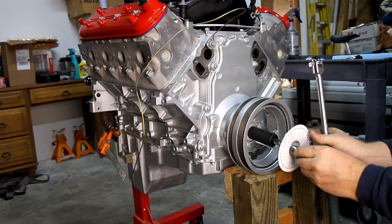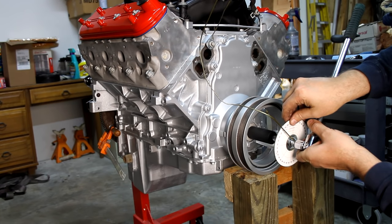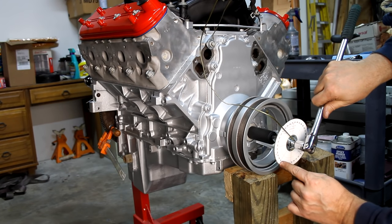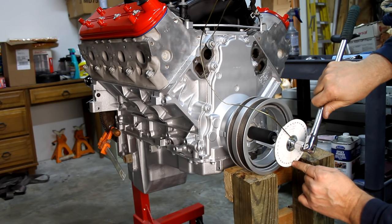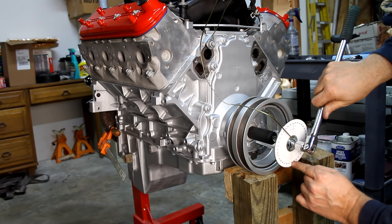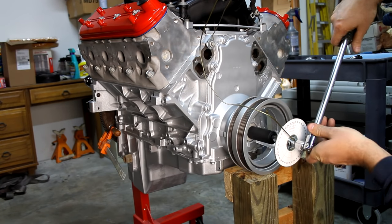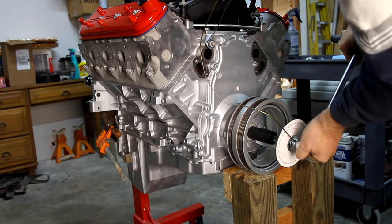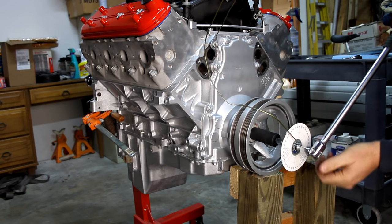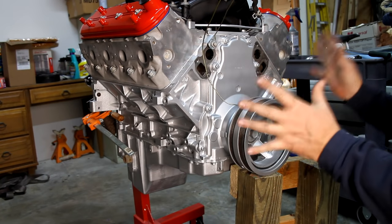And do you remember our handy dandy torque gauge? Okay, so here I've zeroed in my gauge, and we're gonna go 140 degrees, which is 90 plus 50, and it counts back down, so I really got to go here to 40. 90, 110, 20, 30, 40. Yeah, 140 degrees is going to be all the way over to this 40. So that's where I got to get to. That's it. 140 degrees.